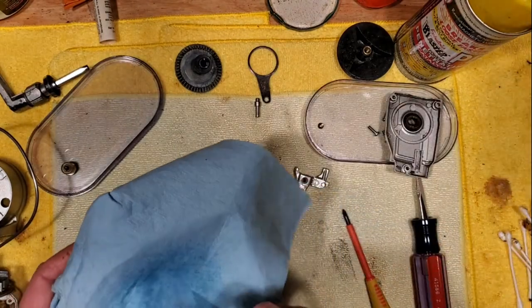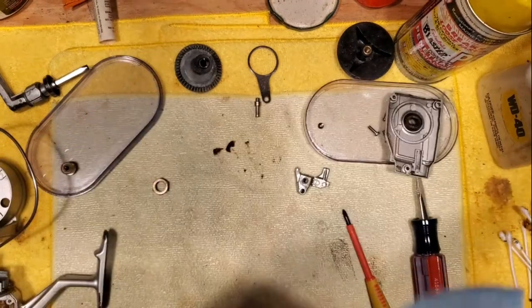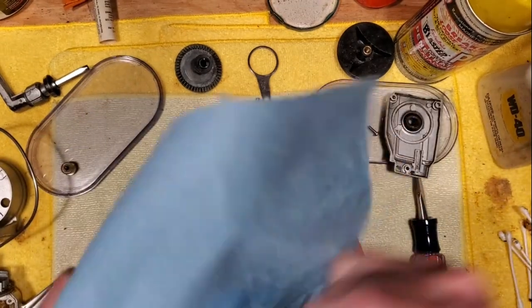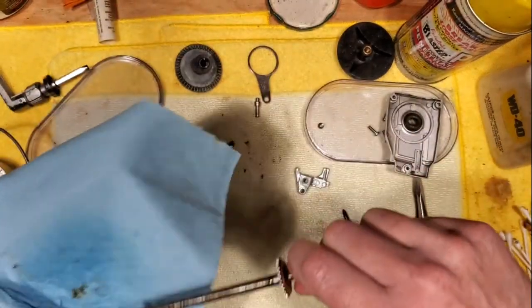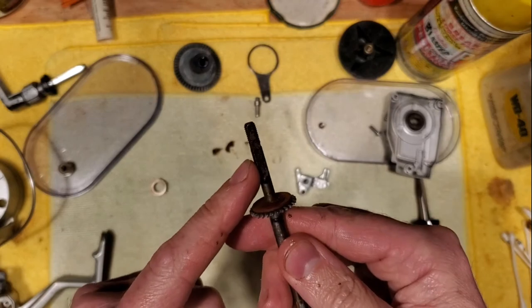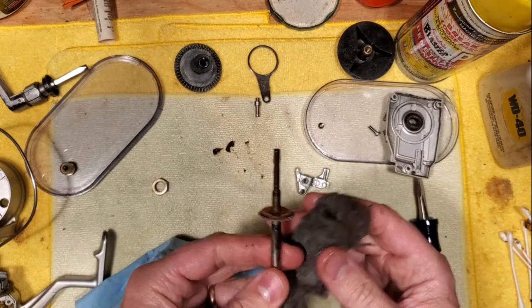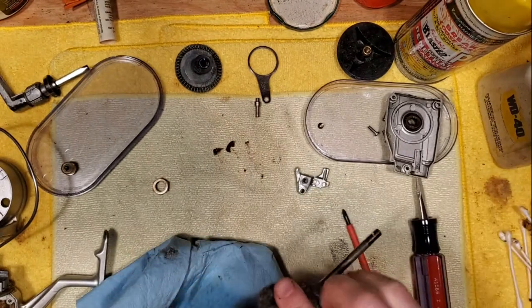I'm going to clean off this nut while we're in here — that's some pretty old, broken down dirty stuff on there. So I'm going to get all that off, clean it up the best we can, and get that out of the threads. And then I'll clean up the axle shaft. As you can see, there's a lot of accumulated really old grease that's been gummed up in there — you can see it's just kind of baked on there. We want to get rid of all that. Even if it's out of the way of the working pieces, it can become dislodged later and move into areas where it can slow down the performance.